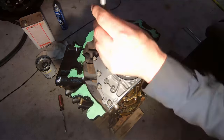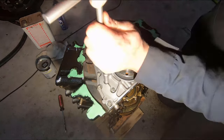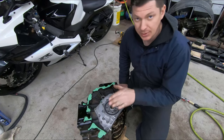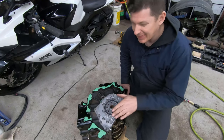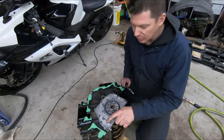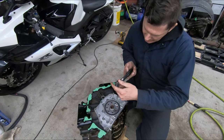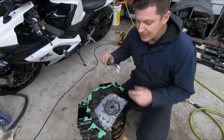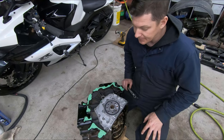I'm going to put my hardware back in and spin it in just finger tight at this point. I've installed my new rear main seal — I've got a new flange which is a Corteco part and it came pre-loaded with a teflon rear main seal. I've got an O-ring gasket underneath that and I think I got this kit from ECS. Now I'm about to go through and tighten my bolts — I'm going to set them to 10 newton meters, which on this torque wrench ends up being 103 kilogram centimeters. I couldn't find a tightening pattern anywhere so I'm just going to do a crisscross and that should be good.